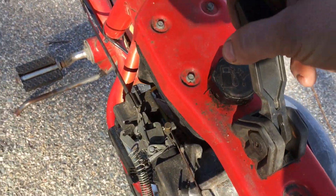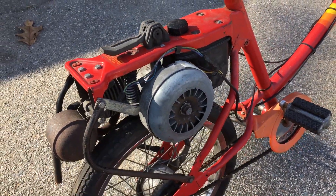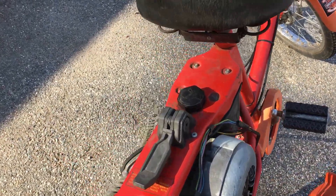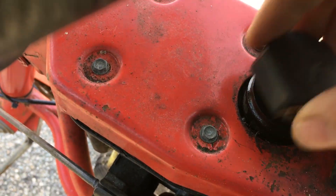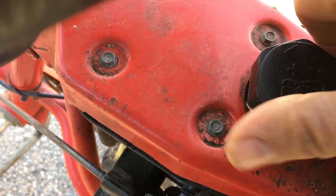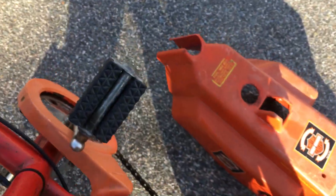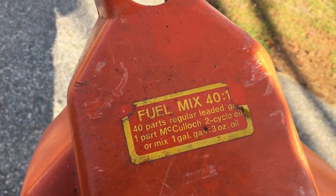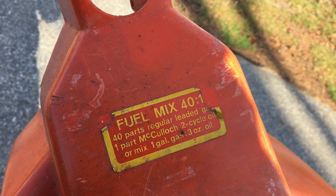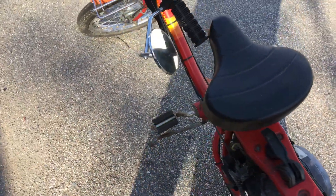This lever right here — you lift the motor off the bike, you can pick it up like that, and it'll raise it off the tire. It's a friction drive. It doesn't smell all that great, but for those of you who have these bikes and don't know what the mix is, it's a 40 to 1 — 3 ounces of oil. Now we know!